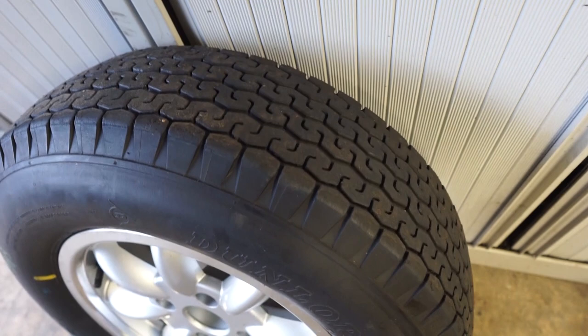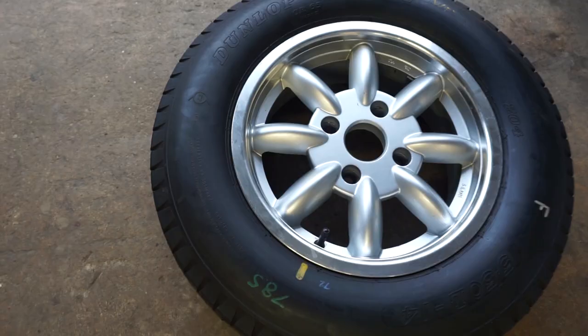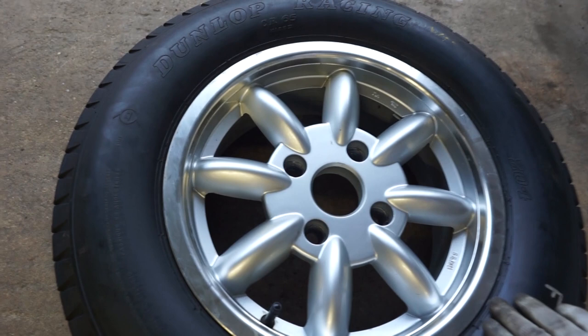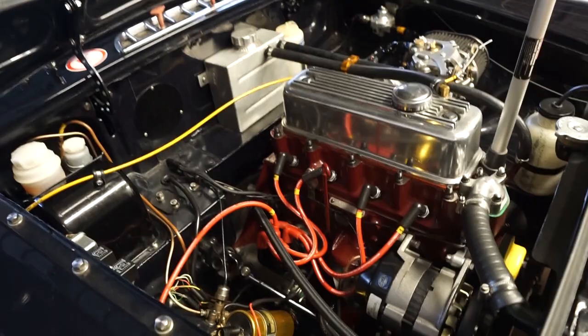The tires we use are specific for circuit racing in the UK - these are Dunlop CR65s, a historic cross-ply tire. They're quite good fun in the dry but a bit of a nightmare in the wet as they don't really grip that well, but they're the ones we have to use and everyone is on the same playing field. The wheels are fairly standard Minilight 14-inch diameter, and I think these are from John Brown Wheels - fairly cheap and fairly effective.